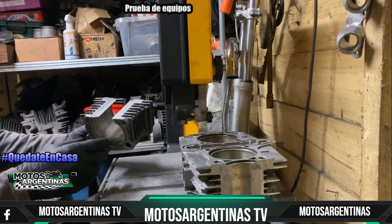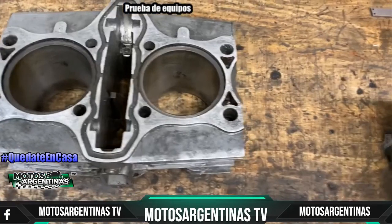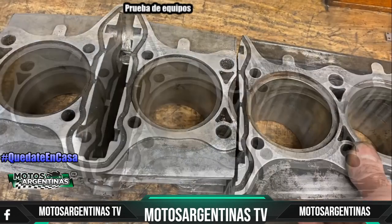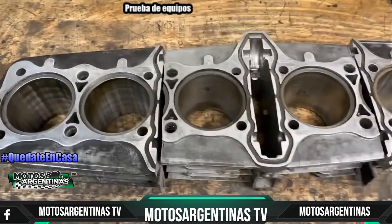Well, that's both the end bits cut off. And the funny thing is I stuck them together and it looks like a weird engine with a funny shaped piston, but that can go in the spares part. Always good to keep the bits for fins, for repairing fins. And there's the centre portion that's cut out. So now I offer up the 2 outer portions to get a rough idea of where I've got to machine it down to get the right width.